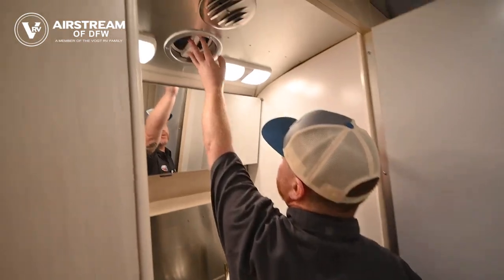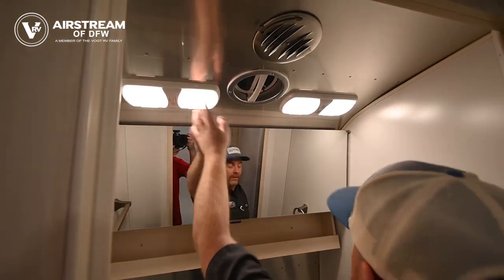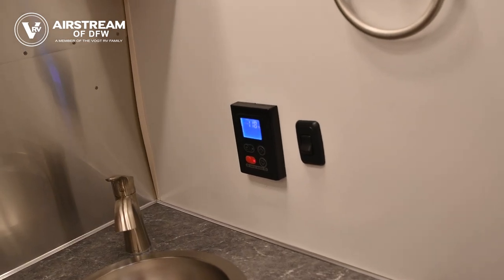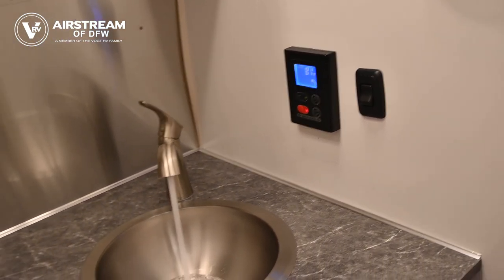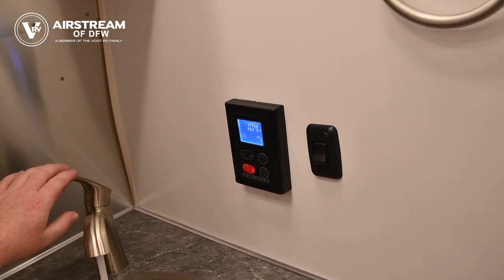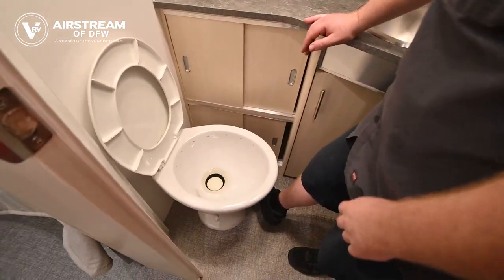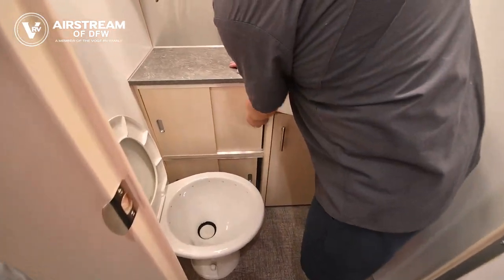In the bathroom, turn the light on here. You've got the same manual vent fan — pushed open, little red button turns it on and off, pull it shut. These lights can be turned off here as well and still operate from the switch. Next to that switch is the control for the water heater — it is already on. You can turn it off by pressing the red button. It's set to 118 degrees and will get as hot as 124 or as cool as 96 degrees. Being on-demand, all you have to do is create a demand — you'll get a little indicator when it begins to work, and once it lights you'll see a flame in the middle. When the temperature crosses about 110 degrees you should already get heat. This will hold the temperature until you run out of water or propane. Flushing the toilet: there's a lever on the right-hand side — a partial step fills the bowl, a full step flushes it. Your tank chemical gets dropped straight into the toilet, and you'll find storage for your toilet paper under the top cabinet mounted to the bottom of the countertop.